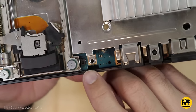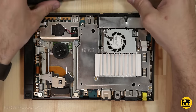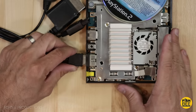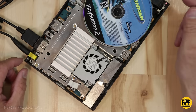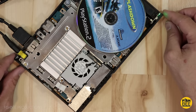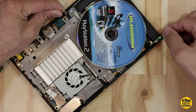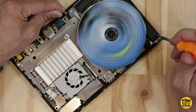Right here is the piece that has to stay down. Here's how you know if that's the issue: put a disc in, and this should start spinning as soon as you turn it on. Watch — as soon as you push down this little black switch it should start spinning. And there it goes. So there are actually two different switches.